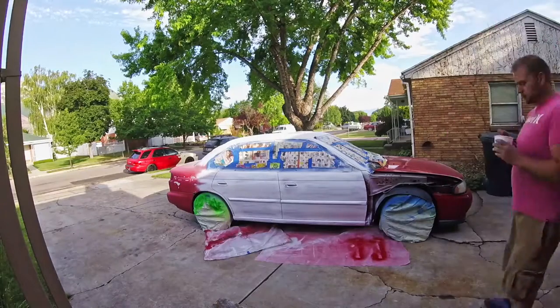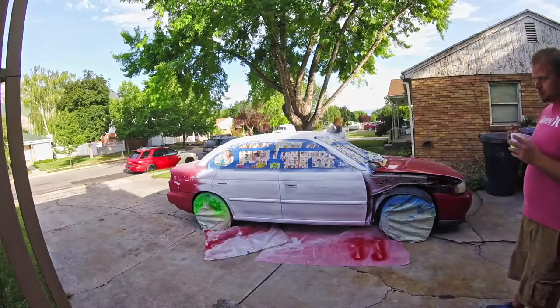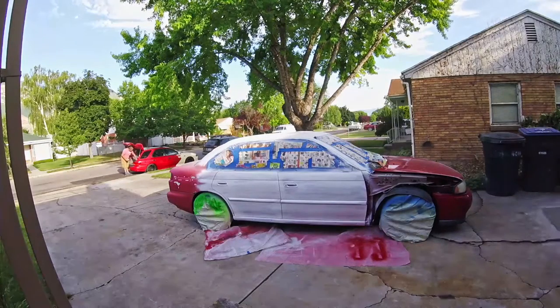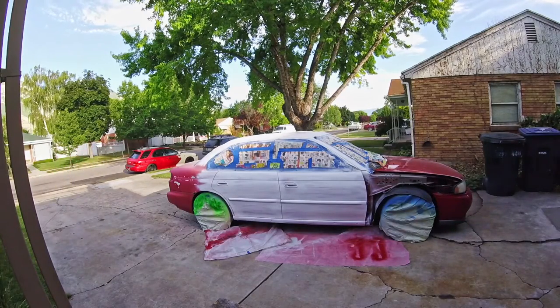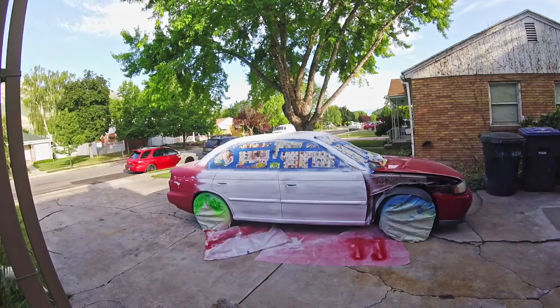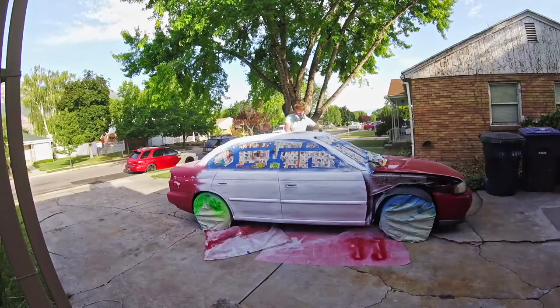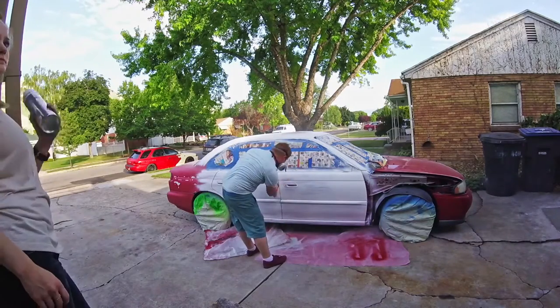My first coat doesn't cover the whole surface — you just want enough paint down to act as a base. In the first coat you can see stripes and areas where the red is showing through; this is on purpose. If you try to get full coverage on the first coat, you're exponentially increasing your risk of getting a run. The last thing you want after spending four days sanding the car is to wait for it to cure, sand it down again, clean and prep the surface, remask a large portion, and then respray it. Your first coat should just be a light dusting — with such a light coat the paint will flash really fast and act as little supports for the heavier coats you'll put on next.